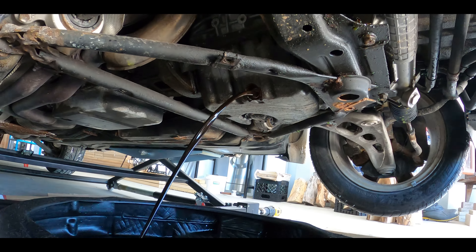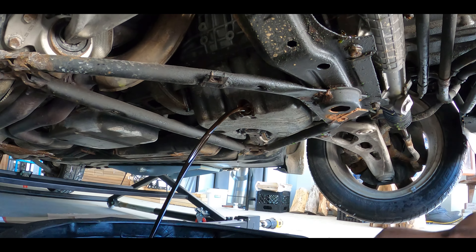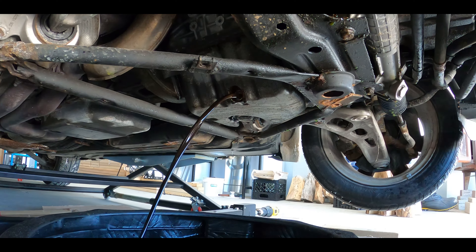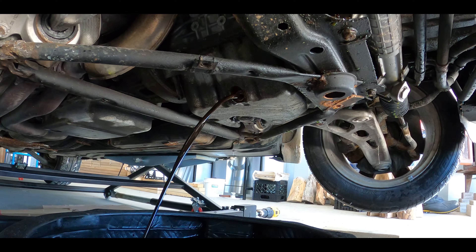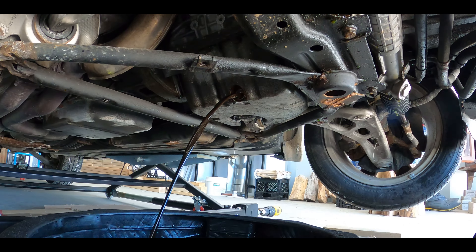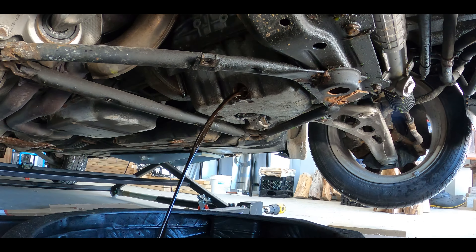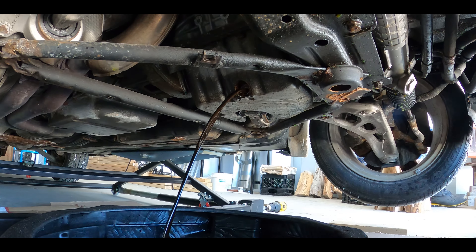Ta-da! It's like Hershey's milk chocolate. It's very brown. Did you notice any water first? I don't think so. Well, that'll be something to check with the pan clean — nothing wet. It's got oil residue on it. When you're draining it, you're checking for water, right? You need to know that.